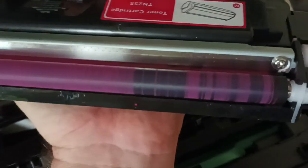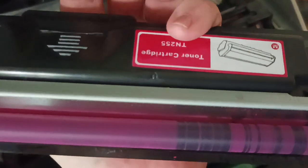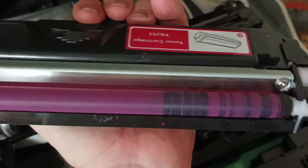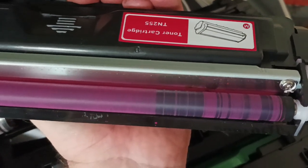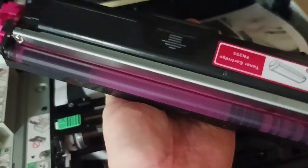This happens due to heat — the toner starts to clump inside the body of the cartridge — and high levels of humidity in the air while you're printing. Especially here in Queensland where it's subtropical, as you're printing the machine is sucking in air through the fans, circulating warm wet air through the printer, and all that moisture eventually makes its way inside the toner cartridge.